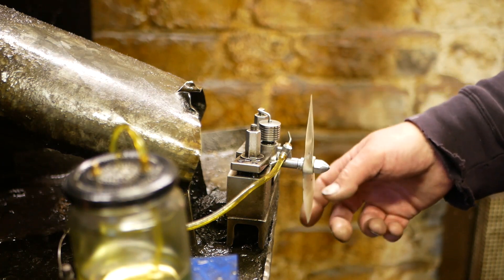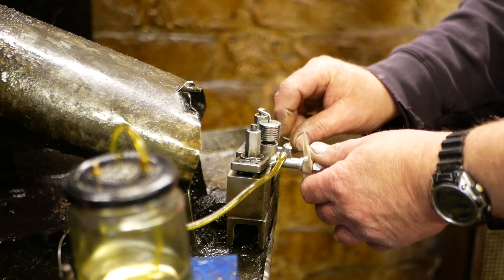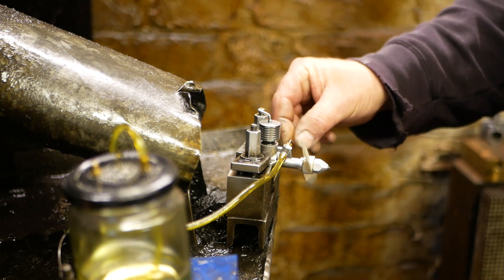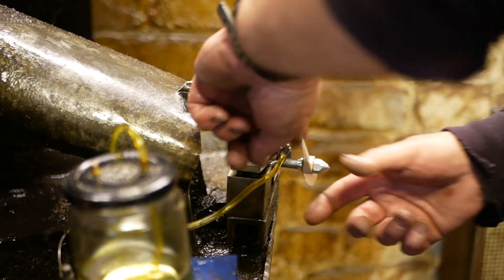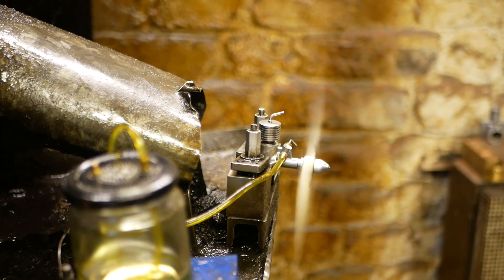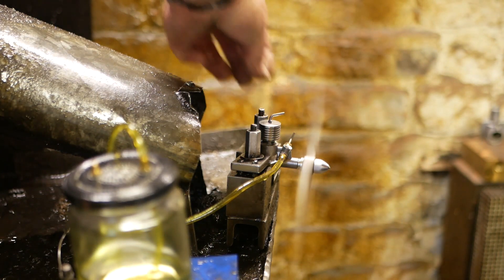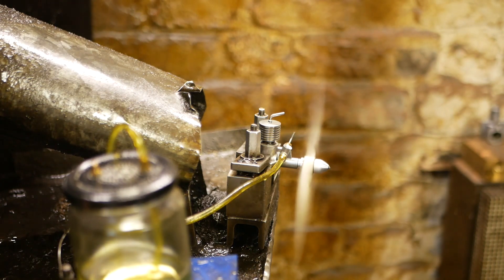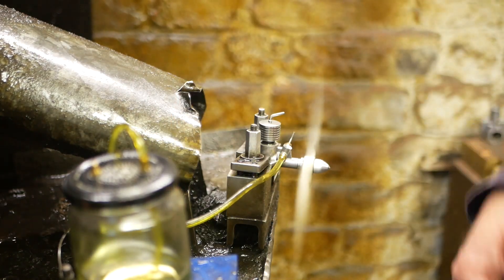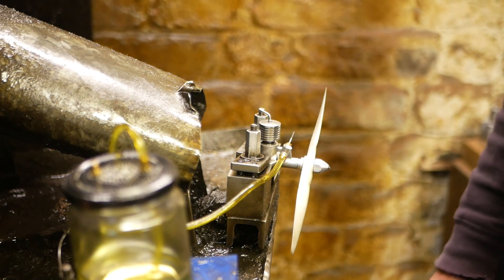Now, in the starting instructions it tells us to start with the needle valve. We have two and a quarter turns open — two to two and a half turns open. One, two, and a quarter turns open — midway in between. Draw some fuel in, turn it to the starting setting, and everything should be okay.